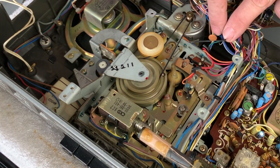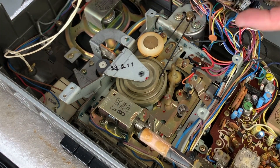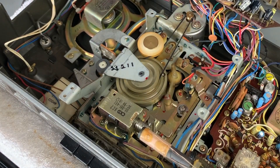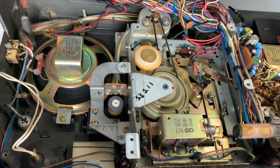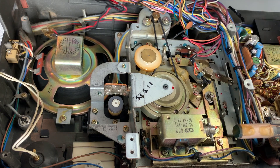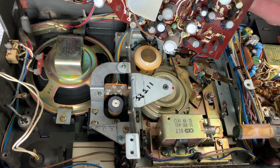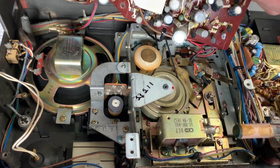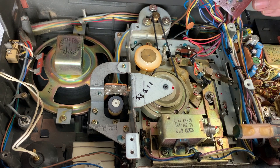Then reversal is the opposite: fold the board back over, don't forget to re-solder your capacitor back on, pop your two white wires back onto the board, fix your four screws in, then put the back cover on - job's a good one. At this juncture you can also go in and clean the leaf contact switch and the erase switch on the board whilst you have access, but for now it's time to put it all back together again.